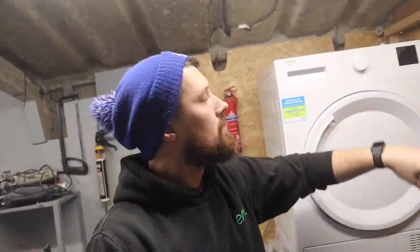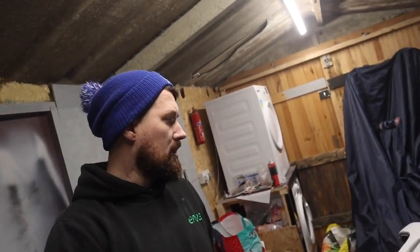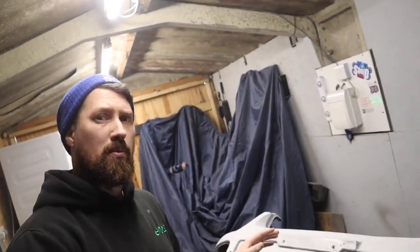Time for a bit of an update. As you've just seen, I've sanded the bumper down and then what I did was I gave it three coats of high build primer. From the high build primer, I was then able to spray over a kind of matte black rattle can just as a guide coat and then we've sanded that all down so that the bumper's pretty much as smooth as I can get it. Not going for perfection because I can't achieve it — I don't have a spray booth. There's going to end up being nibs and stuff like that in the paint, but I want to try and get it as good as possible. So I'm going to take as many steps as I can to try and get this bumper looking really good.